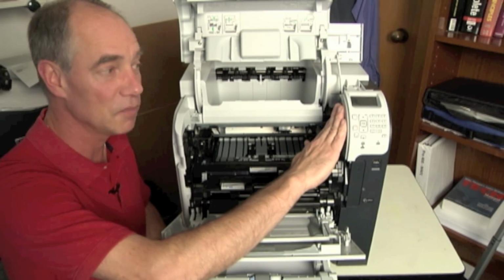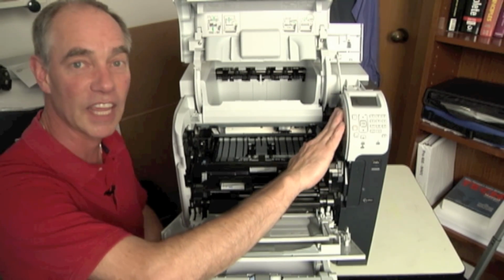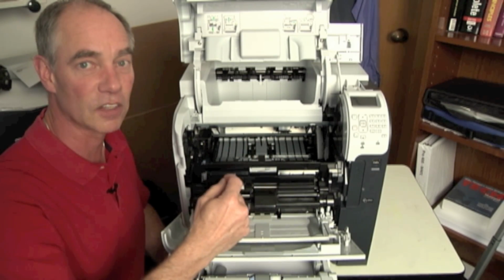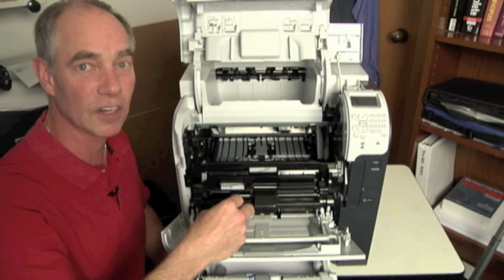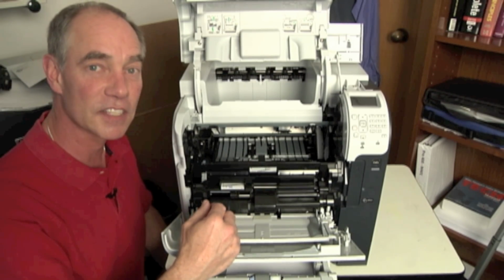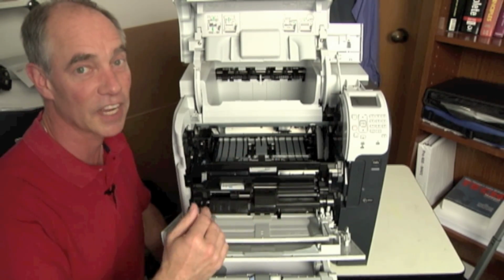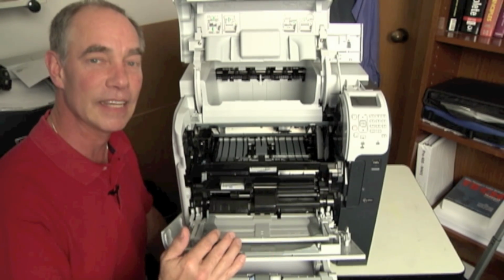On the lower end machines, this becomes more of a guessing game. I use the logic. Well, this is good. Rollers look good. I don't see anything delaying the media. Keep stopping here. I'm probably replacing that sensor because it's either the sensor or the connections to it. Maybe my connection points first. But you're getting the idea here.